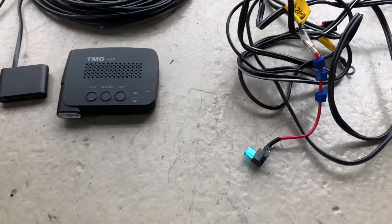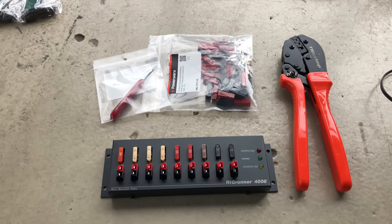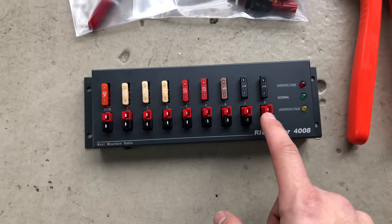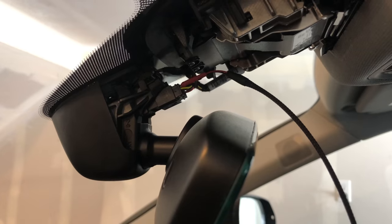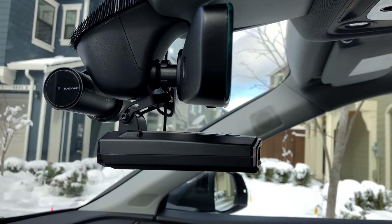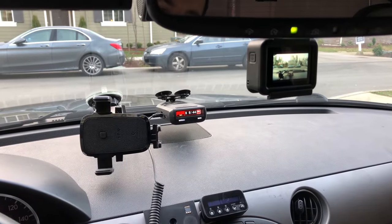For a four-channel solution, I've got two rear dash cams running as side cams. To power all the dash cams I've got a combination of Blackview and Cell Link batteries. For power distribution instead of a bunch of T-taps, I ordered the Rig Runner 4008 — a number of you guys recommended it. It's got an input port and eight different output ports, so I can easily plug in up to eight different systems.